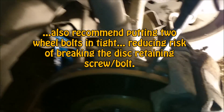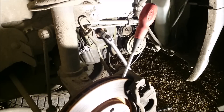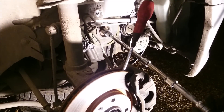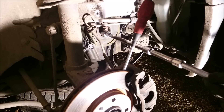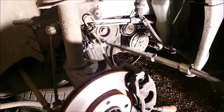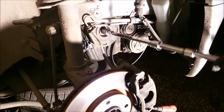We're going to put a screwdriver in the vent of the brake disc — because it's still going to try and turn — and then we're going to get an extension on there and try to undo that crank pulley. I'll be honest, I can't ever remember if we need to go to the top or the bottom, so we'll only know when I try to undo it. We're going to have to put that screwdriver through the vent of the brake disc at the bottom. Either that wheel will spin or this will come undone — and this is coming undone.